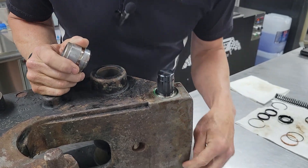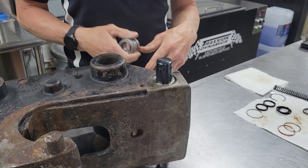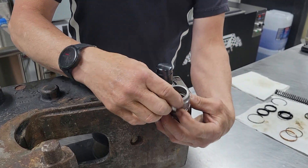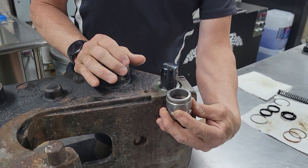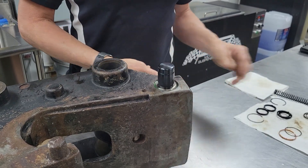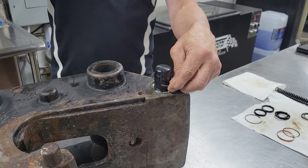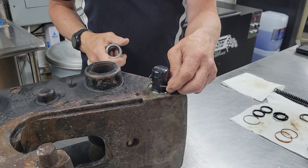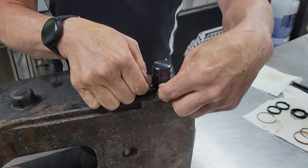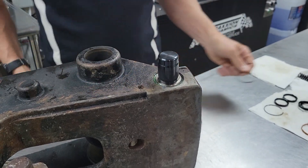If you haven't done it yet, beware — oil is going to shoot out of your hoses. Have a rag or a towel over them. First time you push it, it's going to displace any oil that's left in there. You have to push down far enough; it'll actually bottom out, so you can push this thing down quite a ways. What we're trying to get to is there's a circlip in here. It is challenging to get that out. You'll need a couple of good picks, maybe a flat blade screwdriver. It's difficult to get it started. Once you do, you can wedge a screwdriver under it and keep prying with the pick and wedging the screwdriver further until eventually it'll come out.